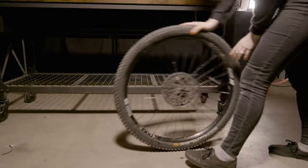You should hear no air leaks and see no bubbling of sealant anywhere. If you do hear or see these, shake the tire to see if the sealant will plug up those holes. If it doesn't, go check over everything again. And if you still can't figure it out, it may be worth checking with your local bike shop to see if they can help figure it out with you — it may be a bigger issue than we can see.